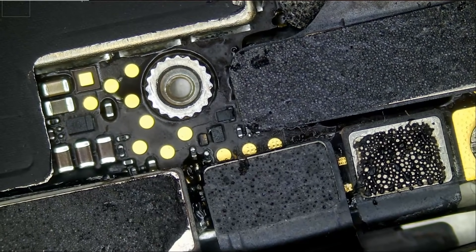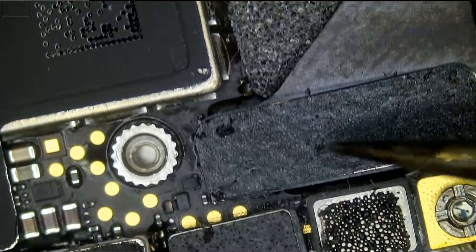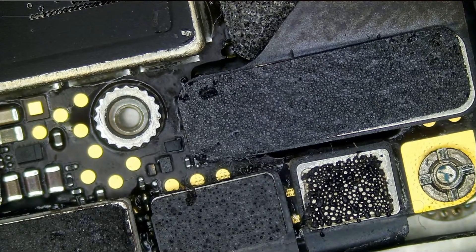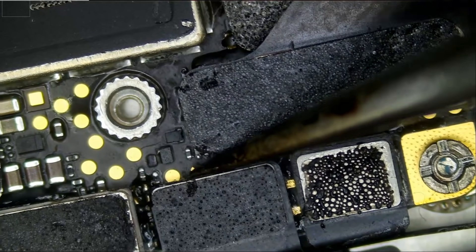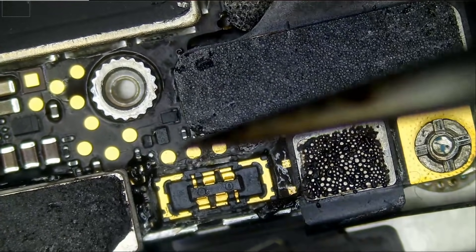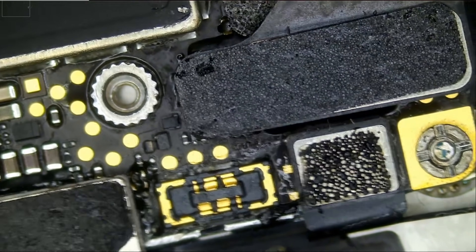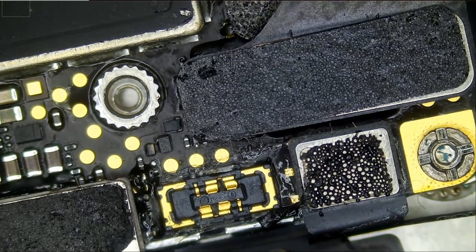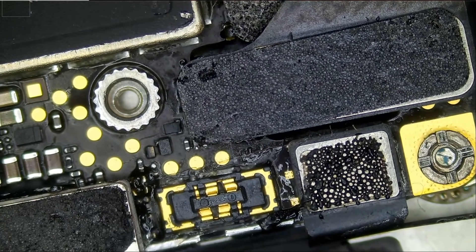Let's take a look at the phone from the inside. We have the battery connector here and we have the screen connectors right over here. A common mistake a beginner makes when prying the battery connector off the board is they stick their nail in this area and lift upwards. But sometimes by doing so they can also knock off this MOSFET that you see here. When that MOSFET breaks off the board, the phone will no longer charge, and that's what happened here. We replaced that MOSFET for the customer and the phone is charging again.